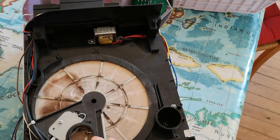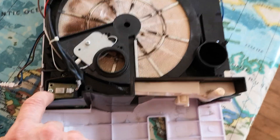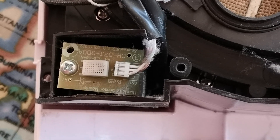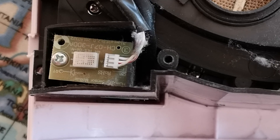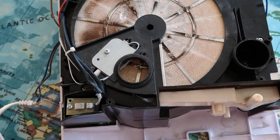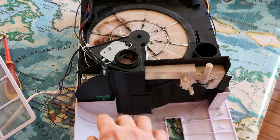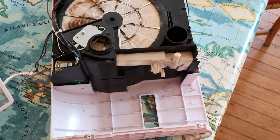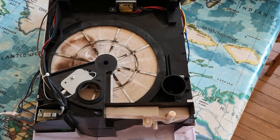There are various modes. There's a humidity sensor down here - RH IS06N - which was quite fluffed up so I've cleaned that out. This does automatically cut off; you've got three humidity levels you can set it to. You can also set it to a laundry mode where it'll just run at full power to keep your laundry dry. There's a tilt sensor, and there's a magnetic hall sensor switch for a magnet in the top of the tank to make sure the tank is fitted. It's a £150 item, all brought down by the fact that the boss in the center of this wheel had worn out.